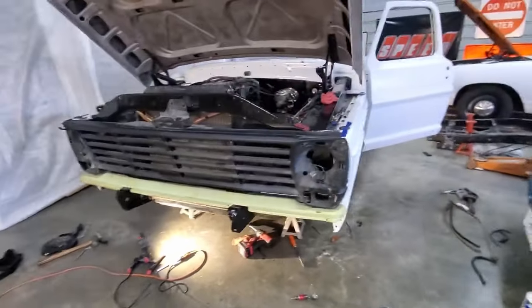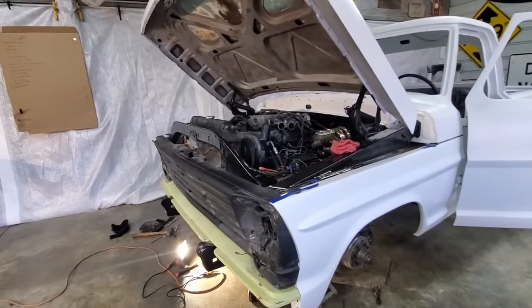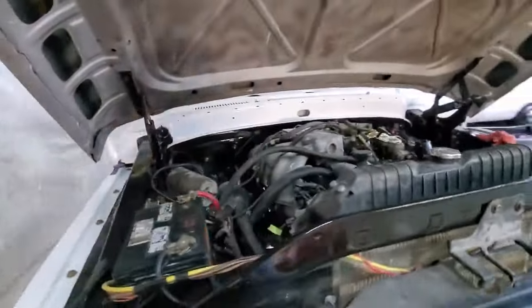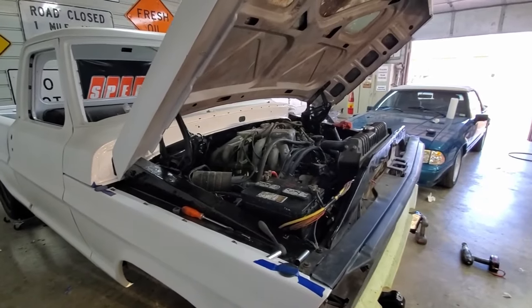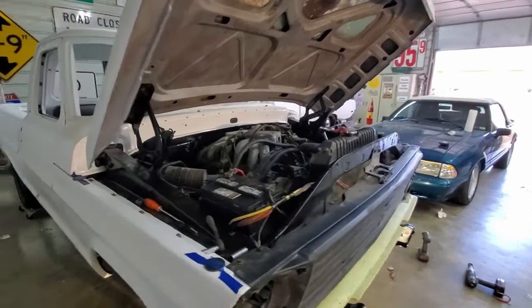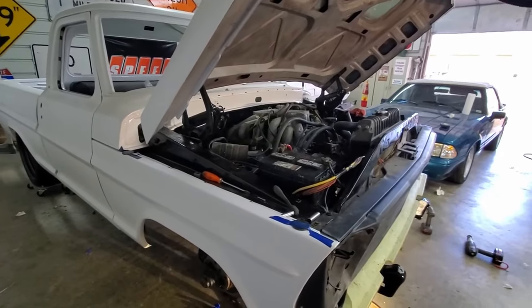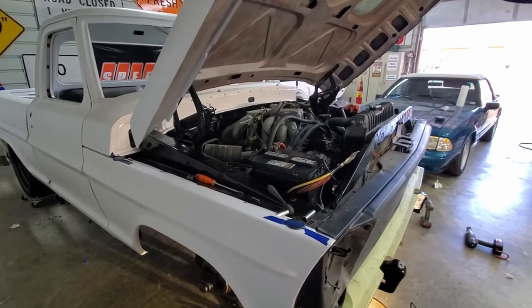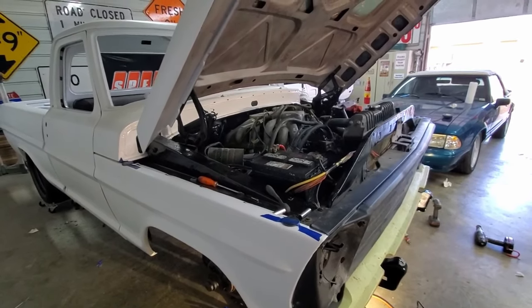All right, I'm gonna kill it. Check the oil. And then probably fire it back up. It's probably gonna need a little bit of oil because I filled it minus the oil filter. I put a new filter on and changed oil when we did this swap. Obviously because the pan was off, but I figured I better change the filter also. I had already changed it when we put it in here, so figured I'd start from scratch.